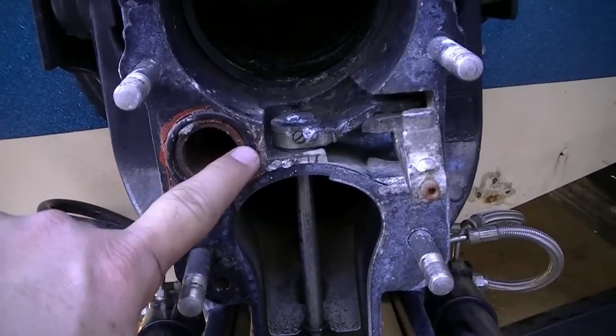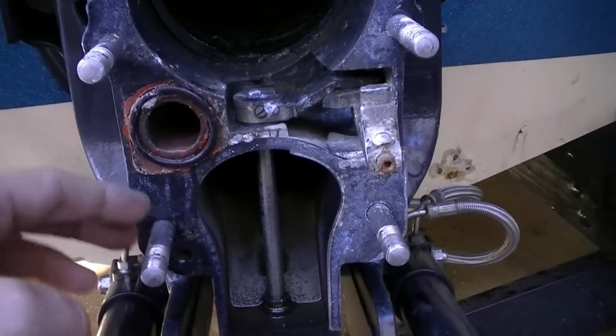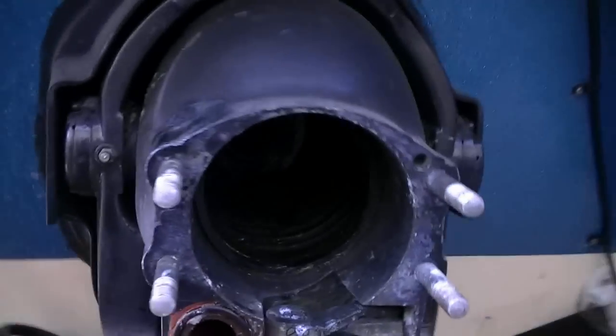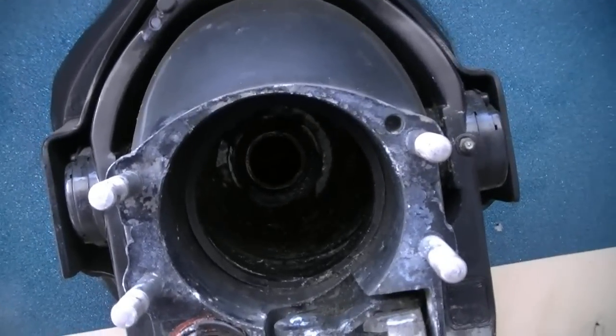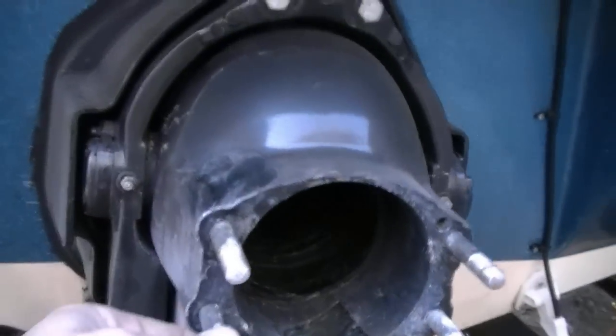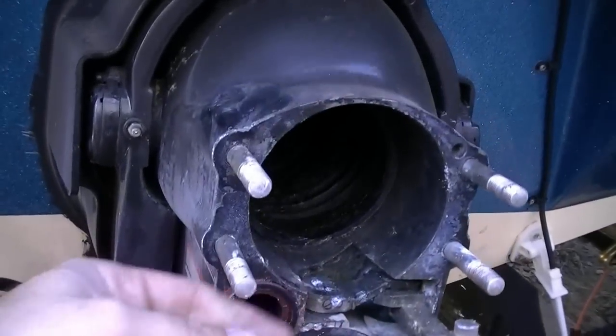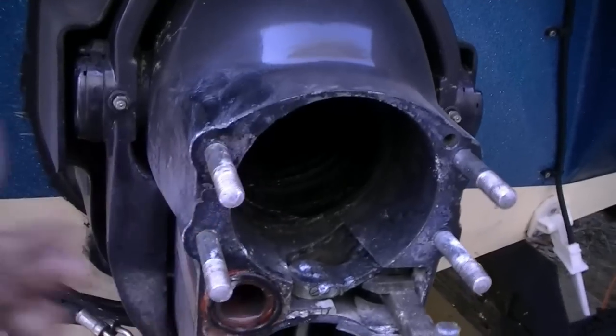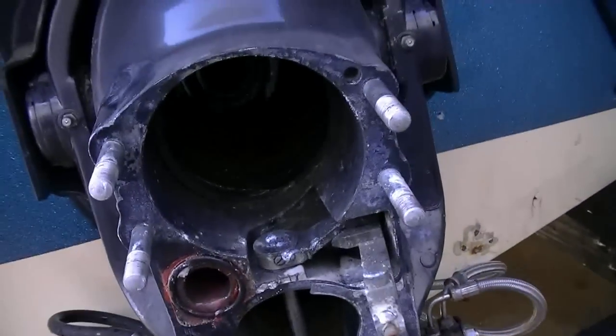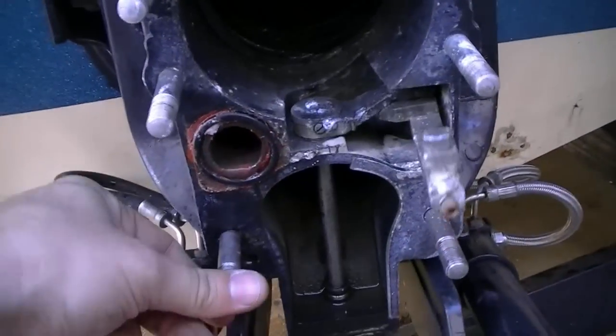Here's the water inlet gasket. You just want to inspect everything and make sure that it's 100%. And I replaced the bellows this year, so it's new and we don't have any issues. You can see how it was kind of sitting at an upward angle. That means that bellows is kind of developing a memory, so you want to store this boat with this down. You also want to make sure all your water's out. You see it still coming out of there.